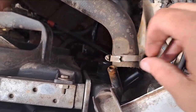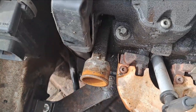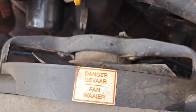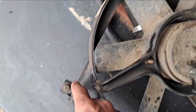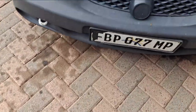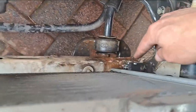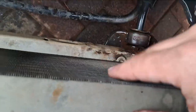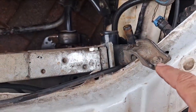As you guys can see, we have a leaking radiator and we're going to attempt to repair it. Up to this point I've removed all the pipes and hoses that connect to the radiator. The second step was to remove the fan — it mounts with two bolts and slides in at the bottom on brackets. The leak is next to the O-ring, D-ring, or seal — whatever you want to call it — where the plastic tank meets the core of the radiator.